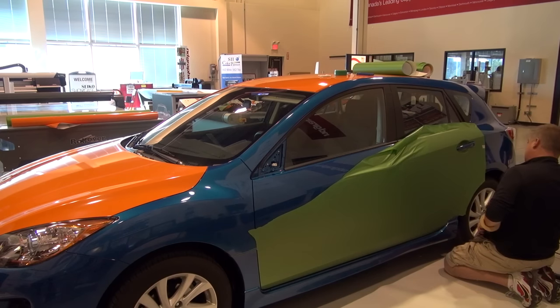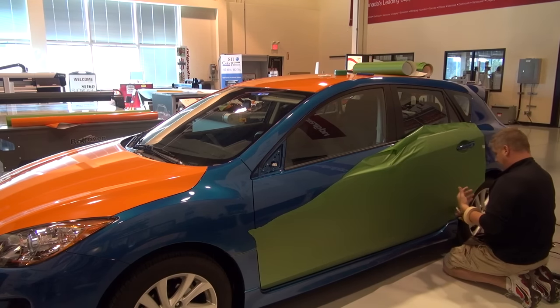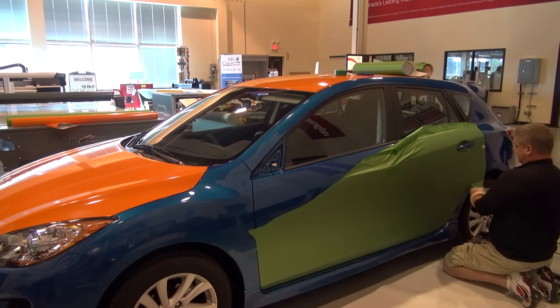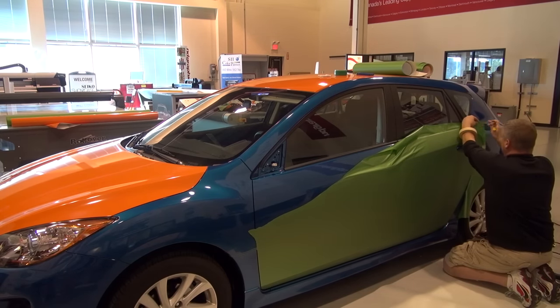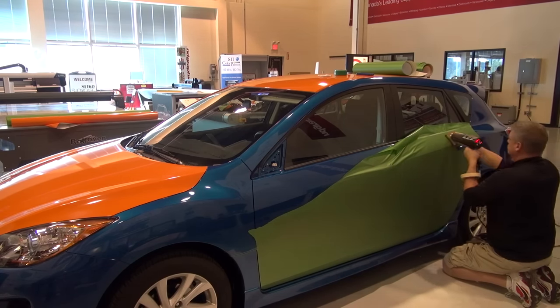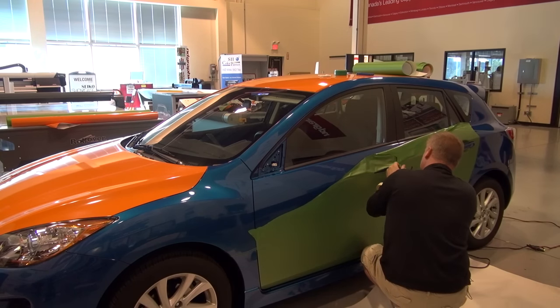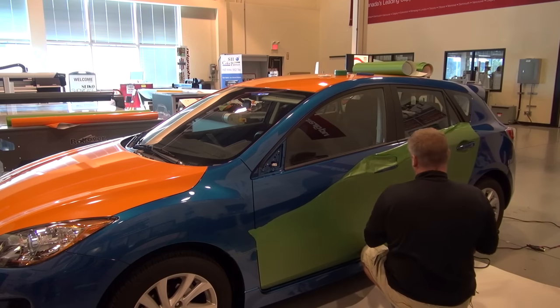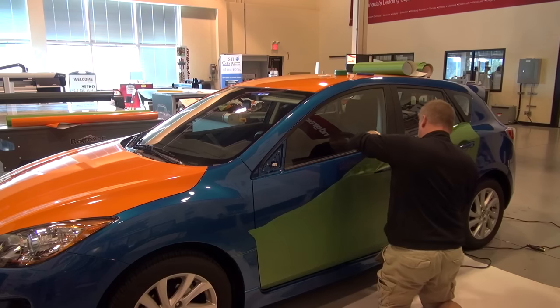So think of it like a paint job. You know, automotive paints stick better to primer than they do to metal. And it's the same with this. The Primer 94, the adhesives love it, and they stick much stronger than they would to just a traditional paint on a vehicle. Very lightly, I'm just touching the score. Let the adhesive hold together, and then it should release.